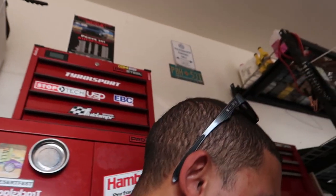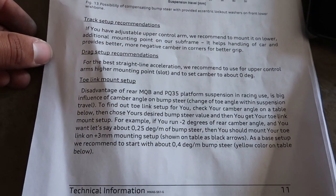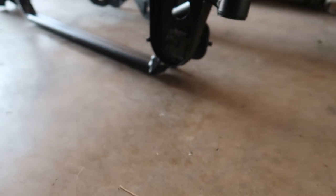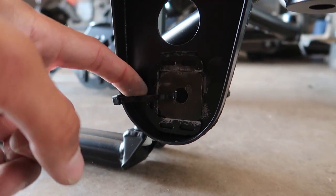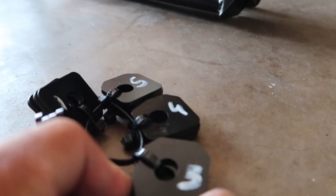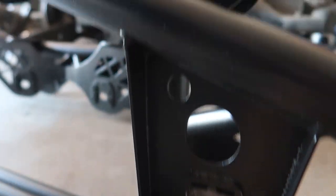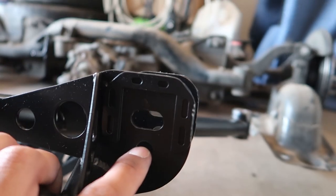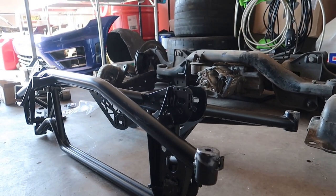I'm going to take the arms off and get these adjustable arms to the proper length, or at least close. I'm reading through the instructions about adjustability for bump steer and all that. For bump steer with two degrees of camber in the back — which is what I run — for toe you need to remove this piece, put in three millimeter shims, and it's gonna raise the mounting point three millimeters. You've got that same adjustability on both sides and two different places where the control arm can go. There's a lot of stuff — it's pretty neat, a little confusing.